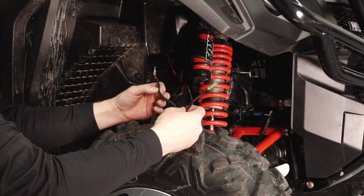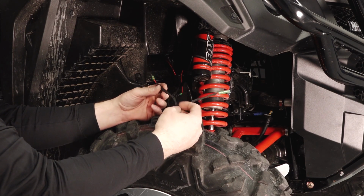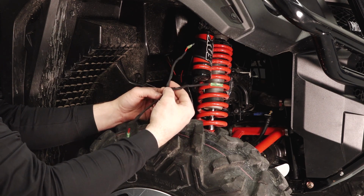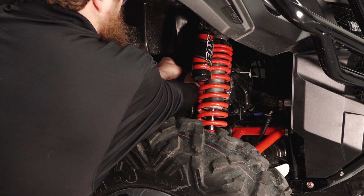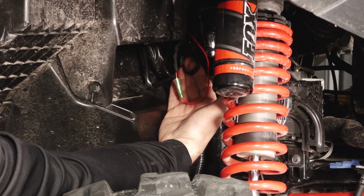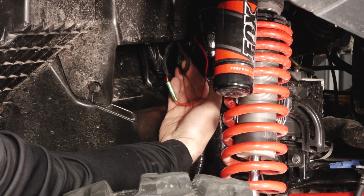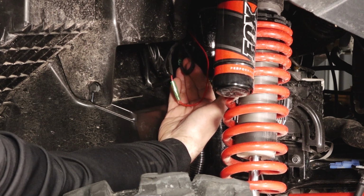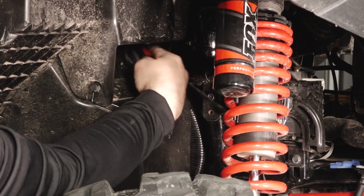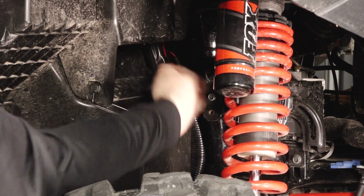We'll connect both switches, the corded remote and the dash switch, together using the power accessory harness splitter. So we connected the splitter into the vehicle accessory power, into the dash socket for the corded remote, and then the harness lead for the dash rocker switch. And then we'll bundle that up along behind the dash.